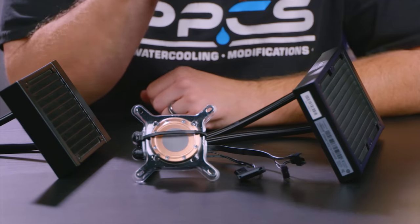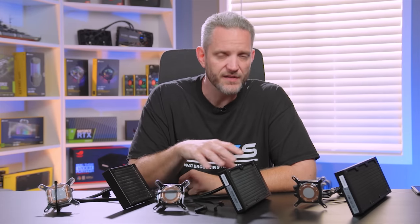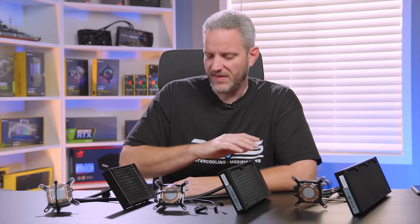A lot of people will take their favorite AIO for features they want — whether it be RGB or expandability — then swap in their favorite fans. Back in the day, one of the most popular radiator fans was the Gentle Typhoon. Unfortunately they're not made anymore, but there are similar alternatives. The Gentle Typhoon was king — the fan to have on your radiators if price was no object and cooling was the priority. All three of these coolers are designed for either a push or pull config. Push-pull is something we've discussed before, and it's a subject with a lot of configurable variables that make it hard to get a concrete result.